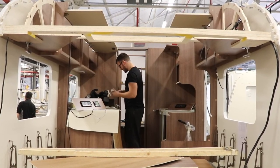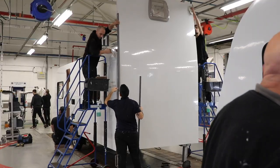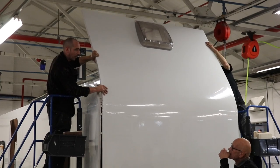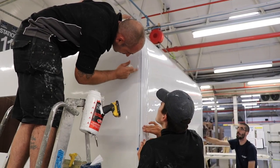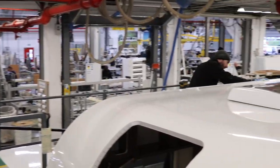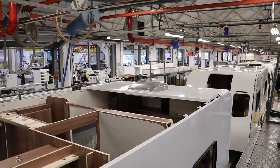Meanwhile the panel and the internal furniture are bolted in place. The strength doesn't come from this alone — the strength is the Alutex system, which all comes together once the roof section is added. The rear panel and rear roof section are added on, bolted into the floor, and the panel is completely flat at this point. Removing the two bracing brackets allows the panel to fold over, where relief cuts have been made, and the outer joints can now be added between the rear panel and the sides. Careful attention is paid to make sure everything is square. Looking down this section of the production line you can see progress is still very rapid. This caravan is arriving to have its roof and front panel added on.